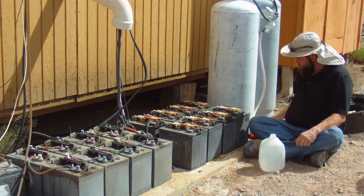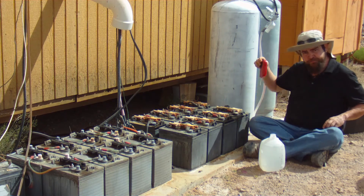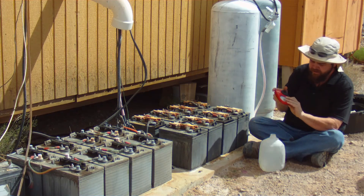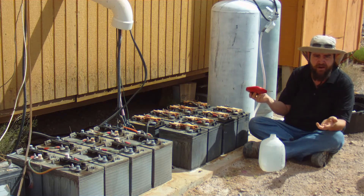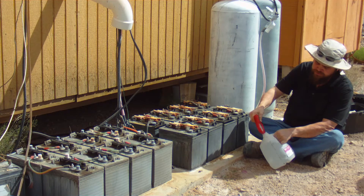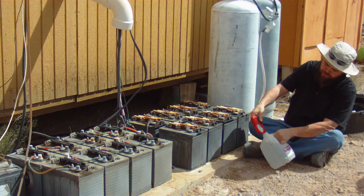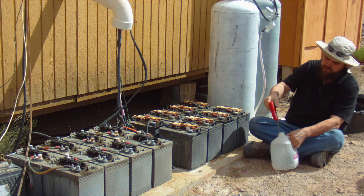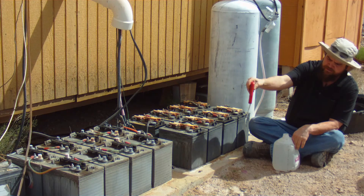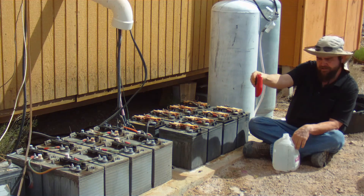Do the same thing with your Hydrovolt if you're using one — this is even more important. The components in here are made of plastic and while they're designed to be in an acid environment, they're not designed to be there for long periods of time. Draw up a whole bulb of distilled water into your Hydrovolt, give it a swish, squirt it out, and make sure you get it all out.